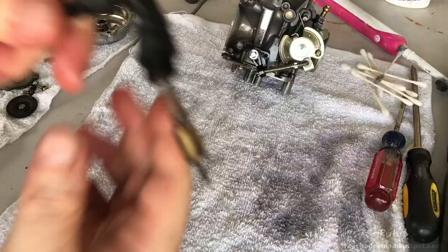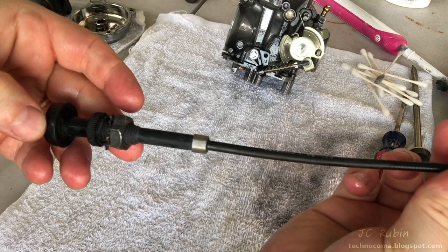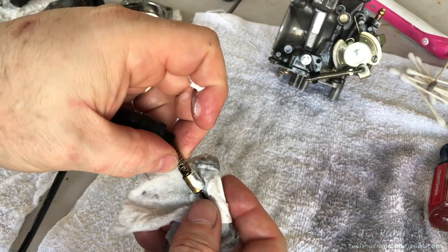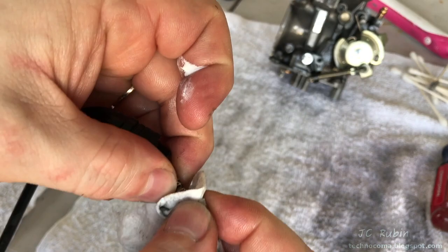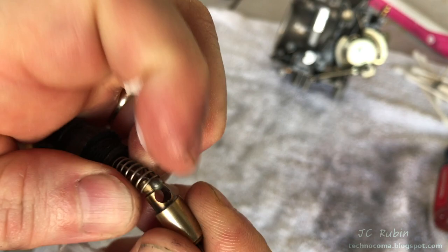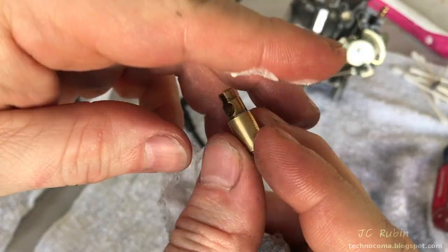Moving items from the left side of the table to the right side. Here we have the enrichener — we can see all the carbon buildup on it. We're going to clean this up with polishing paste, cleaning it while still connected on the entire device. At some point I decide it's just easier to remove the enrichener from the mechanism — pull the spring back, pull it out, and the spring releases. Comes right off with no problem at all.